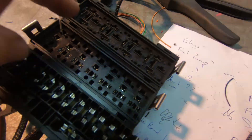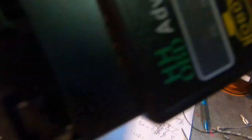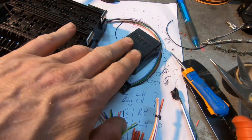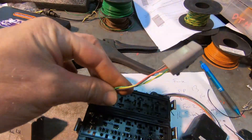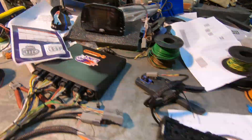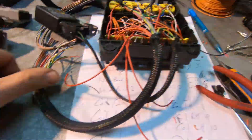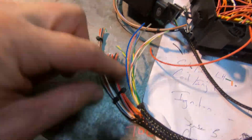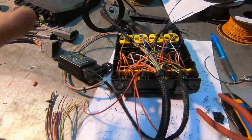I generally use the diagrams available from Link. I often have the fuses after the relays, though it doesn't make a difference - just personal preference. So I've got 16 fuses and 9 relays to be used. I've used one CAN channel for the dongle and the other CAN channel, along with some power supplies and an earth, coming out to a plug which goes to the dash - so by default I've wired the dash as well. Next thing I'm going to do is terminate up these wires which plug into the main loom, and then we'll come back and do a little bit of testing.